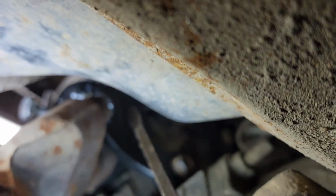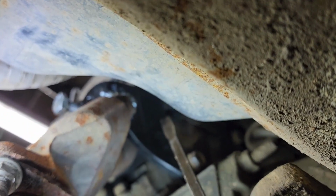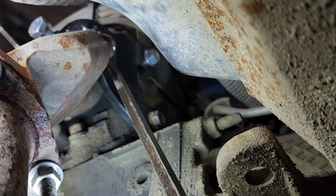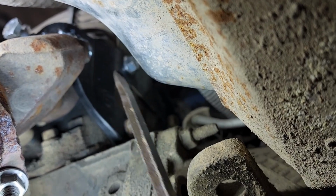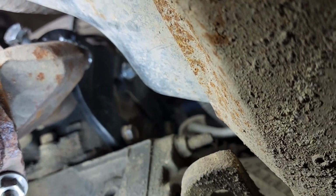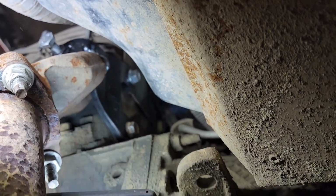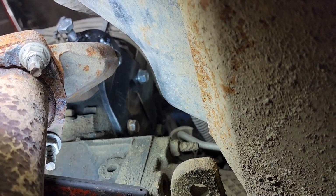And if it touches, it doesn't matter, just as long as the bracket can be put into place and bolted down. So like I say, you may have to grind some off where literally it says USA on our bracket here. Grind a little bit off of that area. It's not going to affect the strength. It's plenty heavy. Okay, well, that's really the installation from below. Now we're going to drop the truck down and we'll show you from the top.